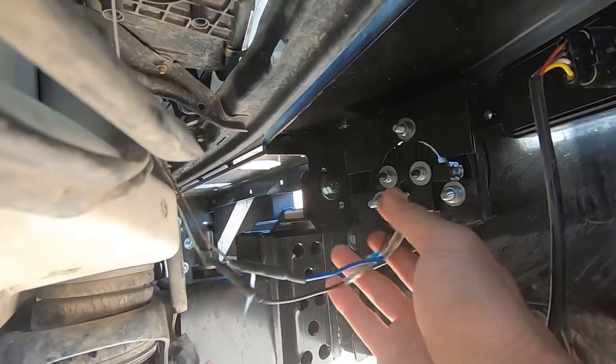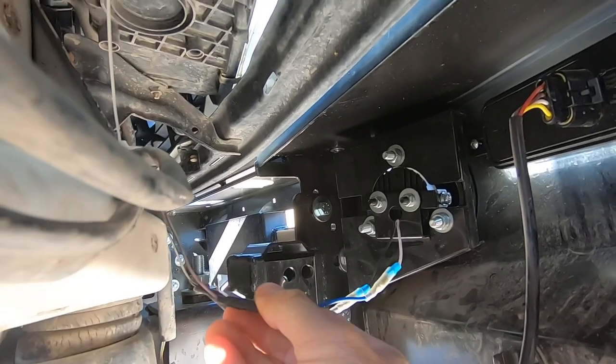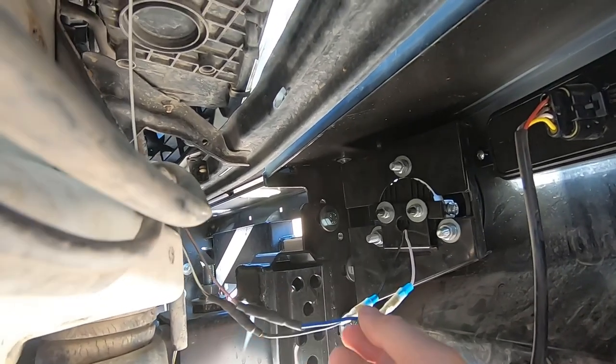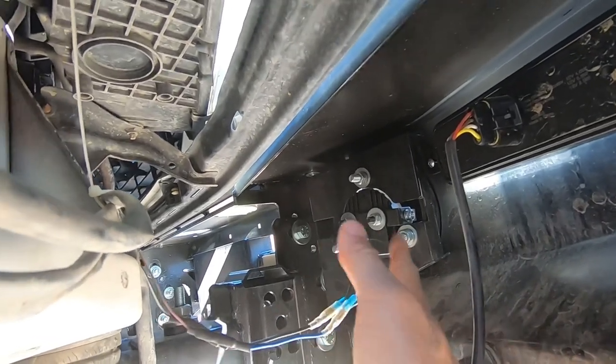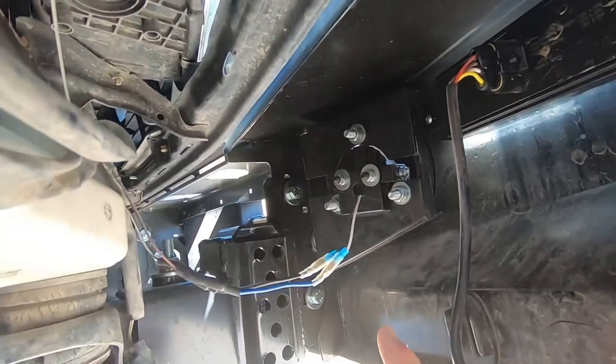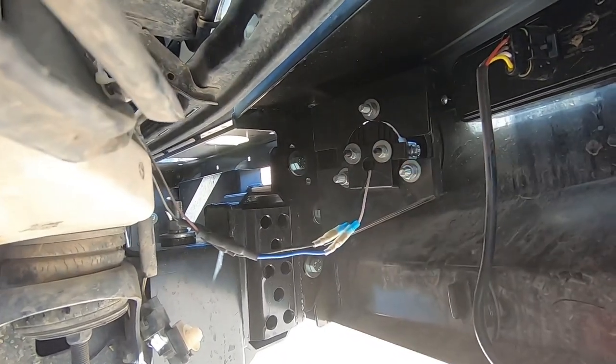The black and red will go to the all-white wire. That's how you do your fogs. I have a solder joint in there, and then I have a quick disconnect right here, just in case I need to change things out. You'll see on my last video when I connected the LED lights, how I actually connected all this and put in the LED bulbs.